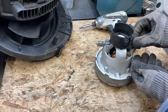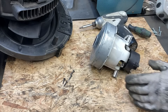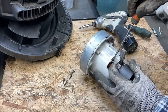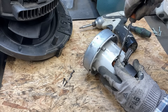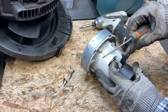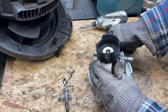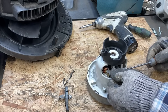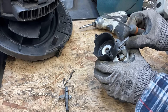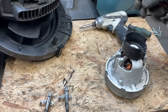At this rate, even if you get it going, it's still going to be cooked. These should just lift up — you might need to ease it out a little bit. You just need to ease out these spade connectors here because they clip onto the windings. I like the design, I think it's good. Brushes have some massive grooves worn in them, but it's popping freely. There's a great smell of burnt plastic here, so I'll get these off and then we'll have a look at how the bearings are doing. Lots of signs of heat there, but still popping freely.